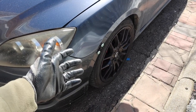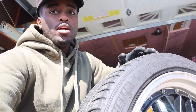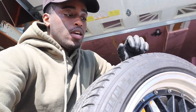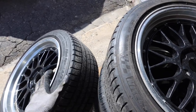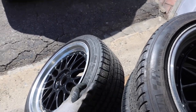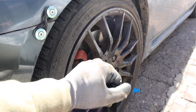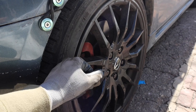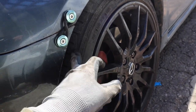I already have black wheels and I don't want black again. For those curious about the wheel size and setup, I'm going with 18 by 9 plus 45 offset and the tires are 235/45/18, which to me personally is right in between a stance and a meaty setup — it'll look really good on the Speed Three. The old wheels are about 18 by 7 or 8 with a 215/45, which is a super small tire and wheel setup to run on this car.